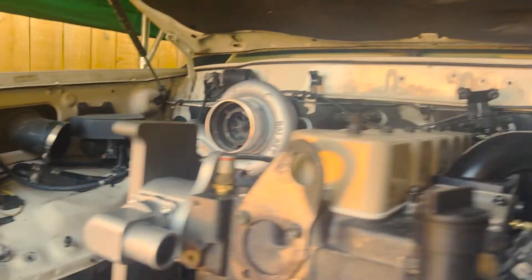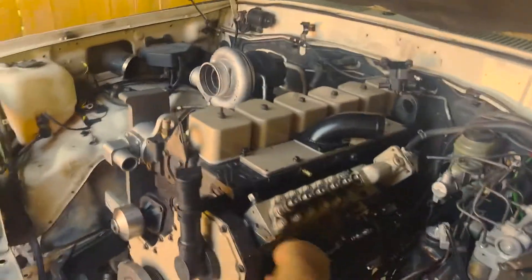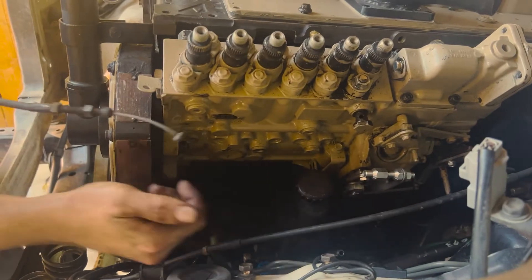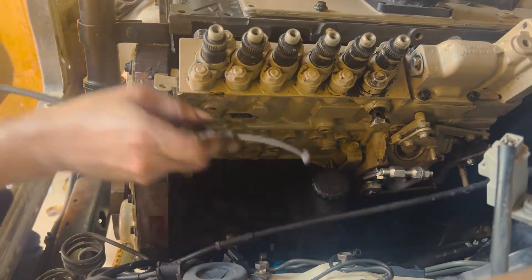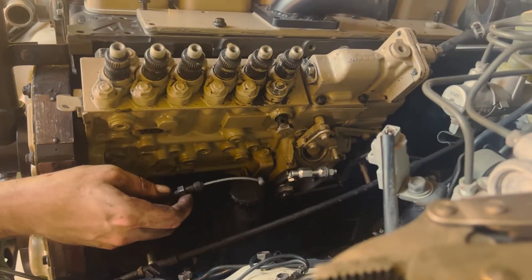One bung we'll use for AC cutoff, and the one in the back is for the temperature gauge on the dash. This is the intercooler piping that's going to go down to the piece I showed you before. Vacuum pump's installed. The throttle cable setup is really cool — we're going to utilize the stock Toyota one coming from the firewall, and we have this little bracket on the p-pump. It's a universal bracket with some linkage that'll connect it, making it 180 degrees right here, and it fits almost perfectly.